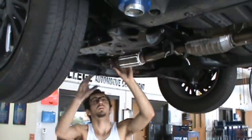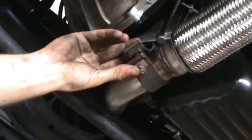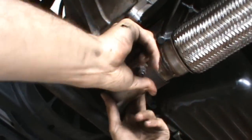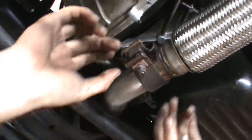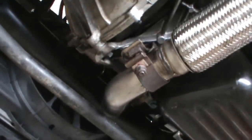And then we got our little piece here. Y'all can see that. This piece that we pried off the other one, we've got that locked in there and it's bolted onto the bottom subframe. We're gonna torque that up as well. And then we're gonna tighten the bolts up here on the top header flange too. So we wanna leave everything a little loose, okay, just so we have room to play.